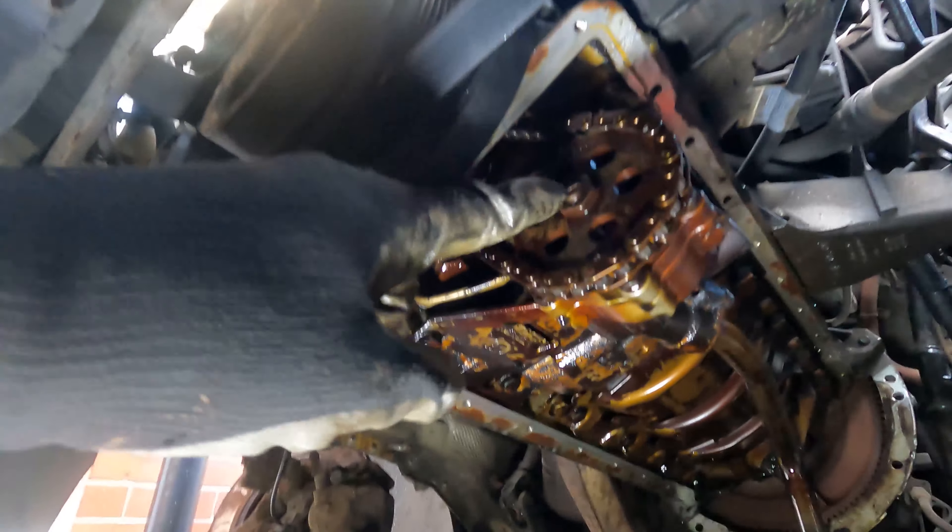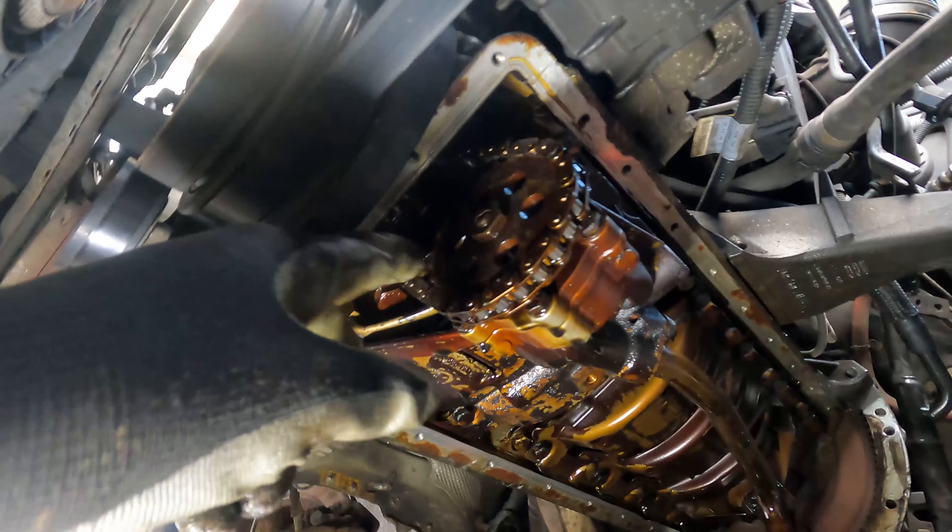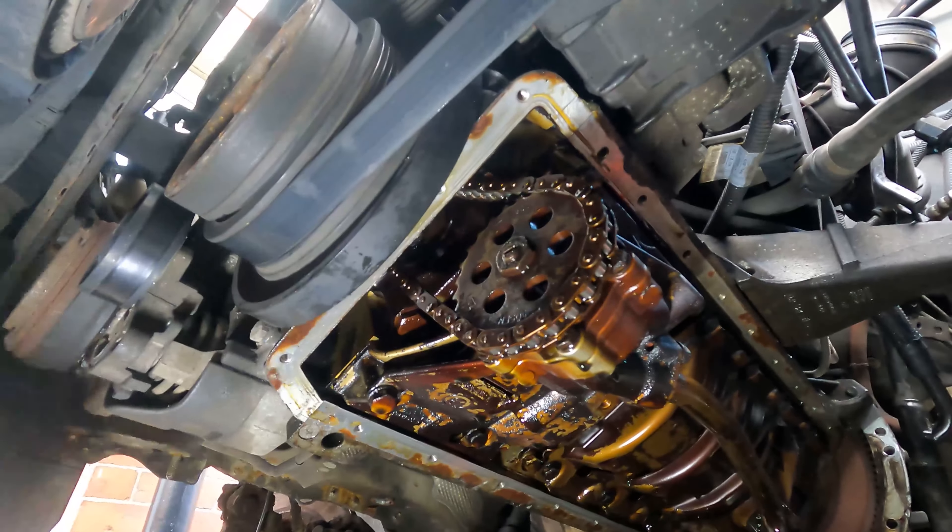There's my oil pump nut — I've got a replacement for that. Apparently on this engine it has a habit of winding itself off when you're driving hard. So while I've got this open I'm going to take it off and replace it. I've got a special nut with a hole in it and some locking wire, so I'll get that replaced. Nice — it's off, finally. Let's get to work.